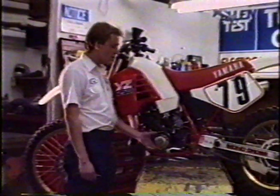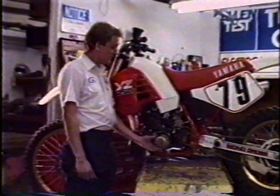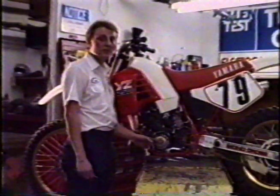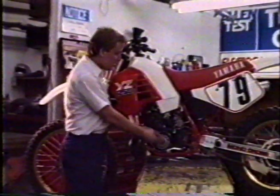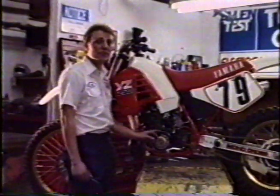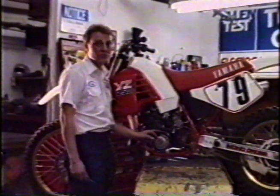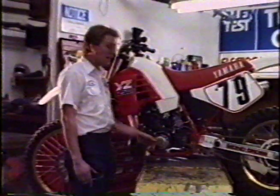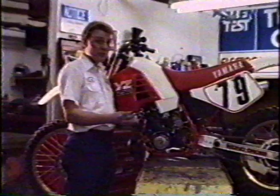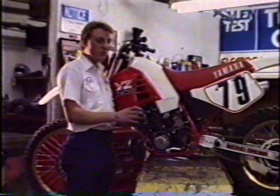To add momentum to the motor and also mellow it out, I recommend adding weight to the flywheel. You can do this by taking your bike along with the flywheel and a flywheel puller to a local machinist, and have them fill the generator cover area with a chunk of stainless steel weighing about 5 or 6 pounds. Start out heavy, you can always trim weight off later if you find that you're losing too much throttle response. Either have him fabricate a cover, or take a stock cover, several of them, cut the faces off and glue what's left to each other, leaving the end one with a face on.